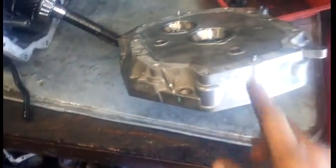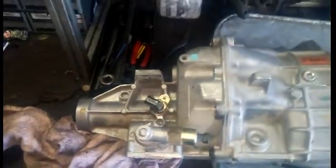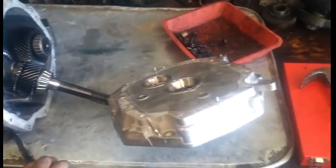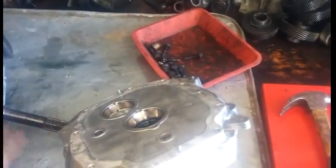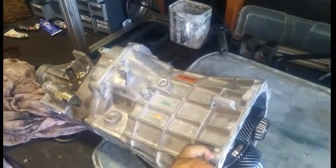That you want to leave on for rebuilding — what we're going to do is leave it on, and then I busted a hole through my table, which was a lot of fun. The input goes down and you're going to stand the transmission up on end. So if you're just swapping the retainer, then you pull this unit apart, swap your retainer, swap your input, and put it back together. Otherwise, you can pull all the bolts out, leave this attached, and flip it upright on the hole into your bench and start disassembling the top half, which I'll show next.